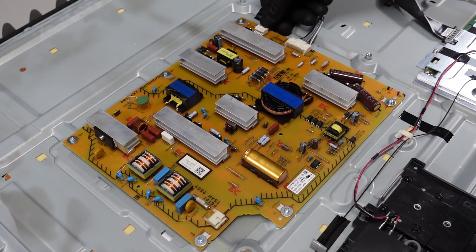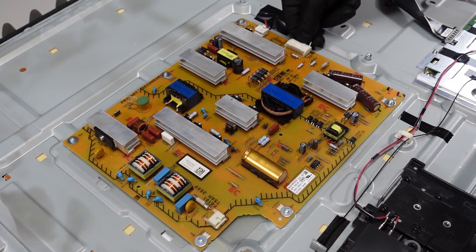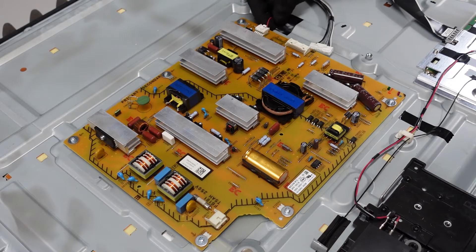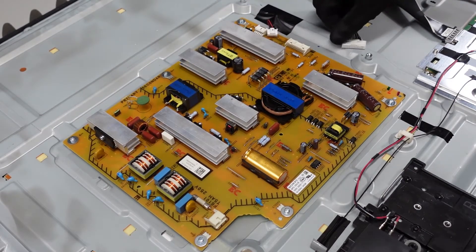The first stop on this train is going to be the power supply. We're going to notice a clip here and a clip here. Both of these are going to be very simple to remove. You're just going to get your finger up underneath of that cable, press down with your thumbnail and pull this one on out. Same thing with this one, but just be gentle because it's a bit more fragile — he's only got two instead of a whole bundle. Just pinch on that top piece and pull that on out.